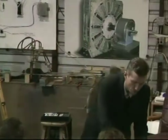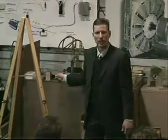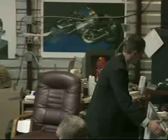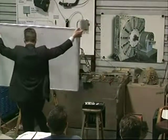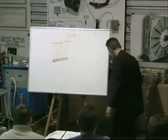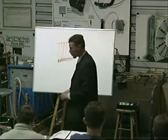Liquid fuel doesn't burn, right? I mean, all that OH radical stuff that we did, that's attacking molecules. And if we've got a liquid, we can't even get to the molecules. We've got this barrier of a whole bunch of molecules clumped together where they're just untouchable. So you look at the vapor points on page 14.